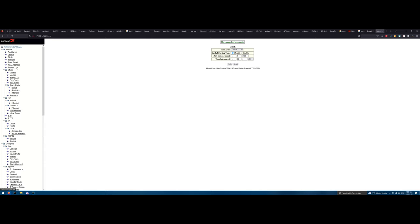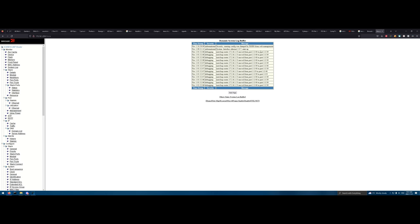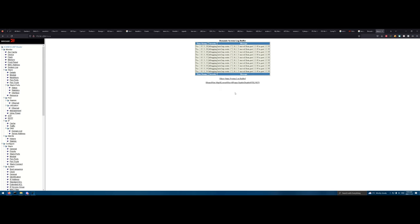The only issue I've had is that with link aggregation, I am getting this constantly. So I've disabled my link aggregation, although it seems to... Oh no, yeah, no, this is 5 a.m. So yeah, if I have my link aggregation enabled for my two servers, it just seems to do this hop router thing all the time. And then when I disable link aggregation, unplug everything, it works fine. So it basically kills my whole network partially, like 80% of the way, if I have link aggregation enabled.